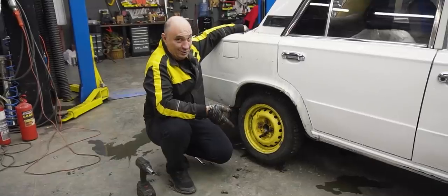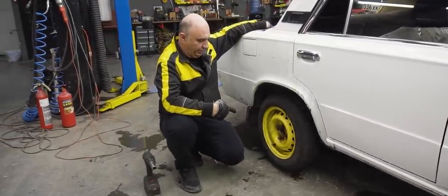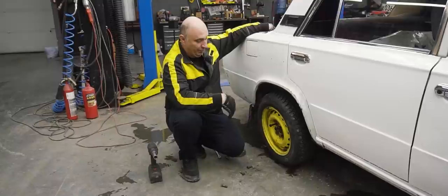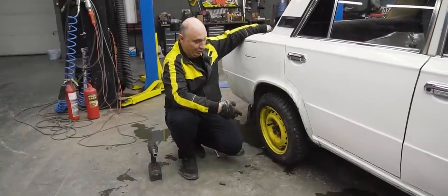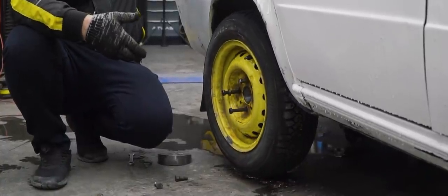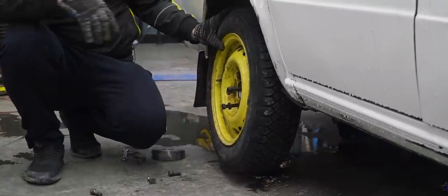When the wheel rotates, you immediately notice that something's up. But if we stop the wheel here, in this position, you can clearly tell that with the lower part pushed in and the upper edge pushed out, it's very obvious that you have some excess positive camber happening. But when you flip it around into the correct position, for whatever reason, you don't notice any difference.